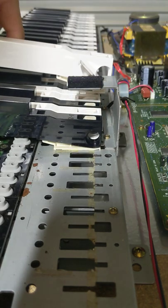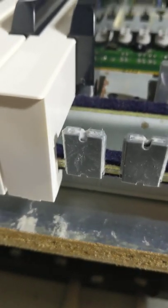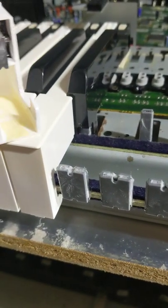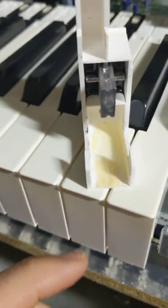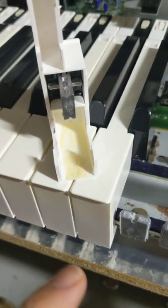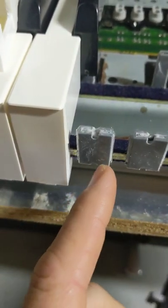The reason why they were sticking down is these little rubber bits at the front — over time it seems like they've actually expanded. I'm not sure what year model the HP 1500 is, but obviously that little rubber bit goes within here to keep the key from flapping around. I'm not sure why it's done it, but for some reason it's just expanded.